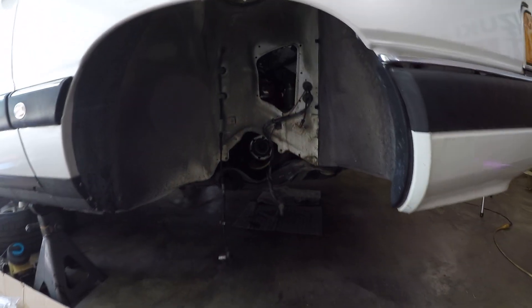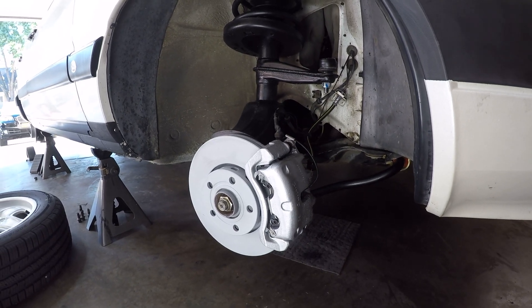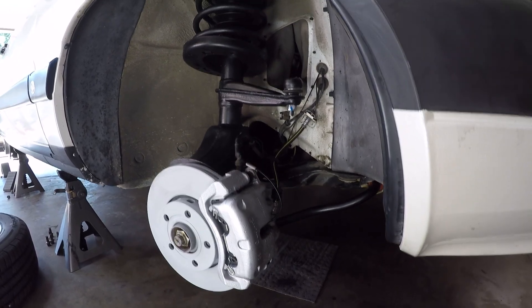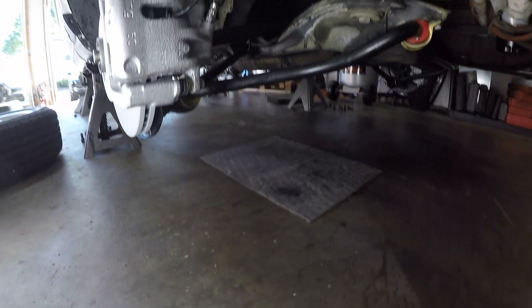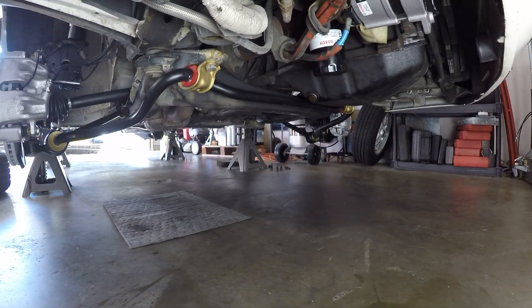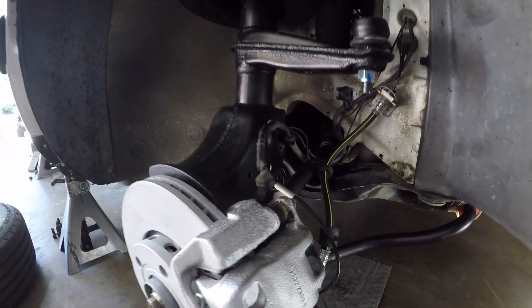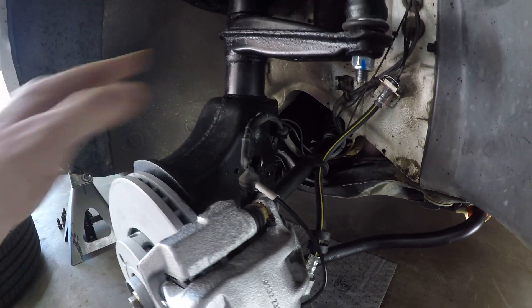There's a lot of work to be done here so I'm just going to go ahead and do it. And there we are — the entire front end of this car is now refreshed, basically brand new throughout. This did take me about two and a half days to put together, but it is now there and looking very nice. Not one inch of this front suspension hasn't been touched. I've also changed the oil and filter. Those brake lines, in fact, worked just fine. I did end up removing the little middle bracket that mounts to the strut because the longer brake lines route through there, but these aren't long enough to use that, so I just removed those brackets.